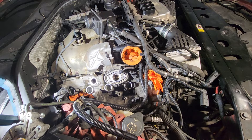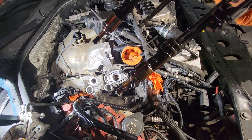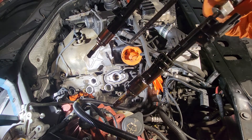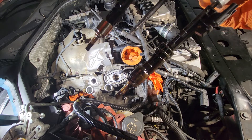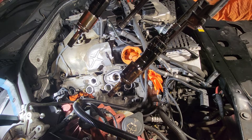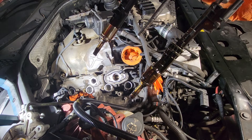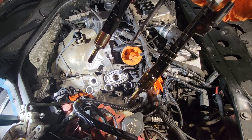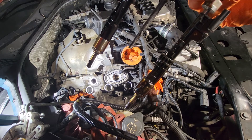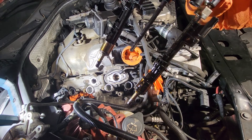Installation is in reverse order. Have you noticed anything in my fuel injectors? Oil, right? I'm working on replacing the valve cover gasket — it seems like the previous owner or mechanic did a really poor job installing it, and there is oil leaking all the way into the combustion chamber causing some blue smoke. I know it's the valve cover gasket because when I removed the bolts of the valve cover itself, they were extremely loose — I could remove them by hand; they were just not torqued at all. That's it — if you have any questions, drop them in the comments.